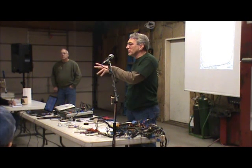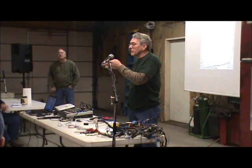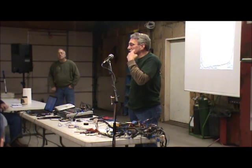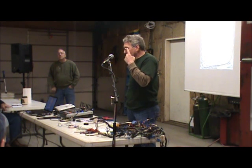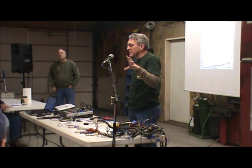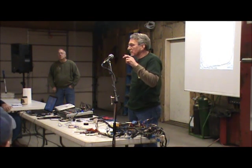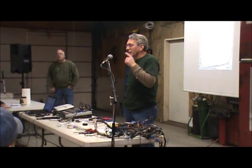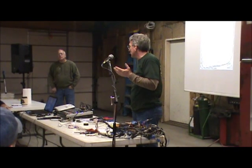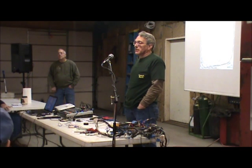If you put in a new, well, in an emergency, you certainly have that. But new radios today, for example, have a constant feed that maintains the battery's memory, or the radio's memory for the presets. But that's a constant 10 milliamp draw all the time. Well, eventually, give it 2 or 3 months of the car just sitting there, you're going to have a flat battery. You can buy an inexpensive battery tender and hook it up also.